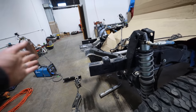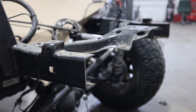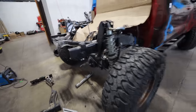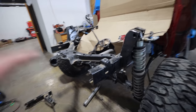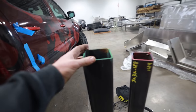The flatbed is going to go out quite a ways past this, so I know this looks ridiculous, but there's just no reason to have all that down there. The flatbed is going to start at a 45-degree angle somewhere around here, but our departure angle is going to be so much better than it was — which was already way better than stock. What I want to do now is build basically a custom hitch slash rear crossmember out of this 4x4 tube.